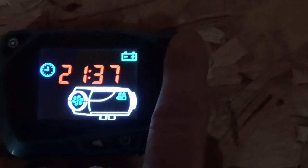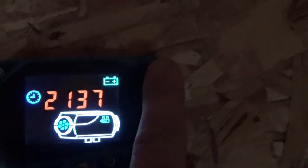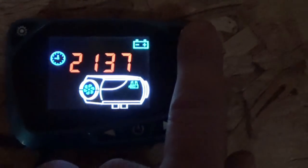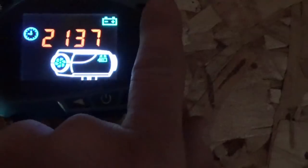It got me out. It reset back to the home screen. I know you're supposed to open up and look at the polarity of the magnets in the rotor of the fan. And then whether or not you have like 2 at the same polarity or 1, you gotta use that proper setting. But you know what? I found what works, and it's safe, and it keeps the casing temperature nice and cool, and it heats up this big drafty barn just fine. So I'm good with it. I'm good with just run the fan on the faster setting. SN2. So I go with SN2.